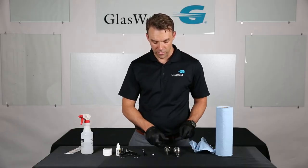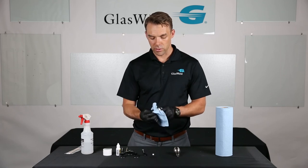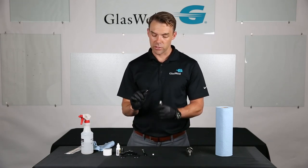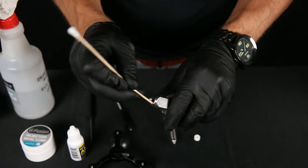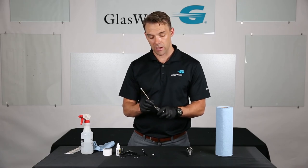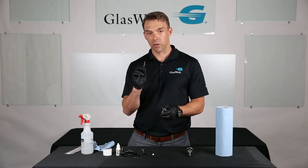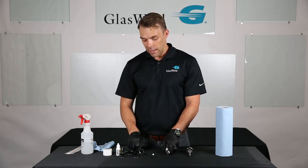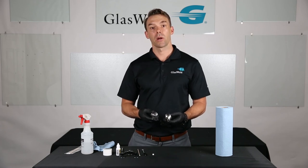Wipe the lower seal once more after applying the denatured alcohol. To verify the injector stays in good condition, use the wooden end of a swab to check the edge of the lip in the lower chamber for any resin buildup — though never use a probe or anything metal anywhere in the injector. If you need to break off some debris, use a wooden toothpick or the back side of one of these wooden swabs. Then either reassemble the injector or leave it separate overnight, and you're ready to lube up your injector and start repairs the following day.